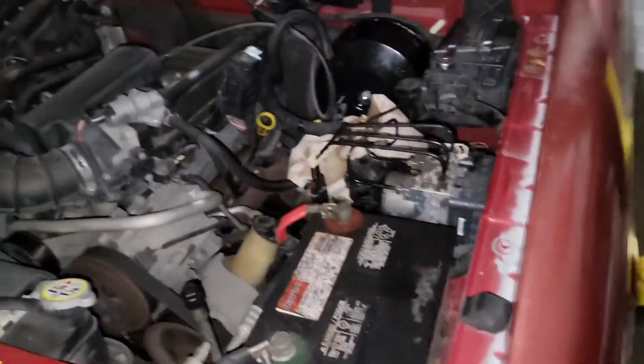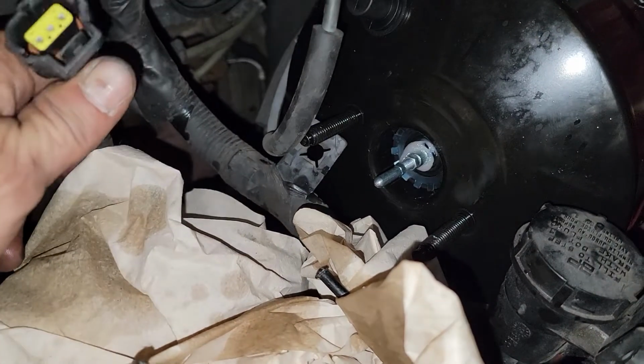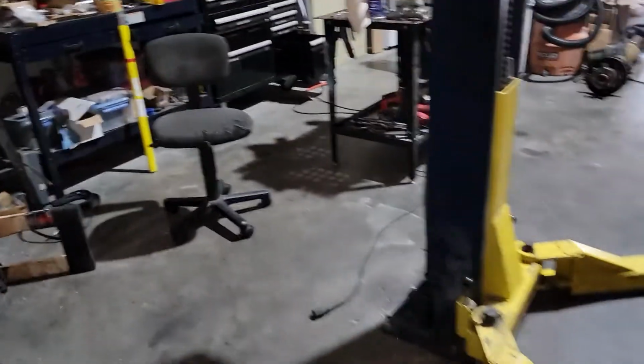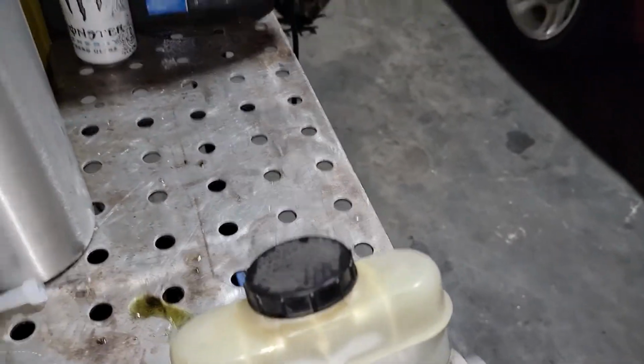And then I also noticed the fluid level plug right there. I guess this is a fluid level. The plug was totally different, so the plug wouldn't even work. He said that was for a 97 Explorer, which maybe if this was a 97 it would work. My main thing is the plug. I could always change the fitting on the line, that's not a big deal, but the plug wouldn't have worked. To run around and get a pigtail would have been a pain in the butt, and then to cut it and splice it, which isn't a big deal. But, you know, I'm gonna grab a factory one in the morning. He kind of mentioned that going to the rear disc, the factory master might not be enough volume, which he could be right. But we'll have to wait and see if that works or not.